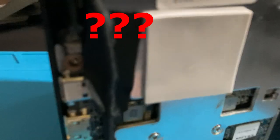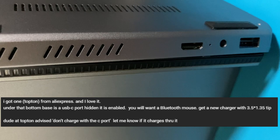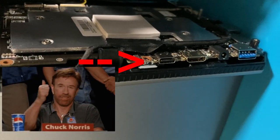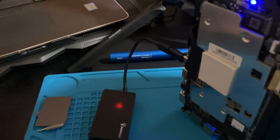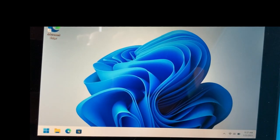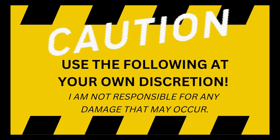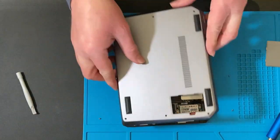Wait, what is this? I got a message from one of you viewers who has one of these about there actually being a USB-C port on this device - and this is it right here. I plugged this mystery USB-C into a little USB hub I have and it powered on no problem. I also threw a USB jump drive into it just to see if I could read the data, and as soon as I plugged it in Windows registered it. However, it doesn't work for power delivery - I tried to put a plug into it and nothing was happening, it wasn't registering as powering the unit. So I pulled that out real quick.